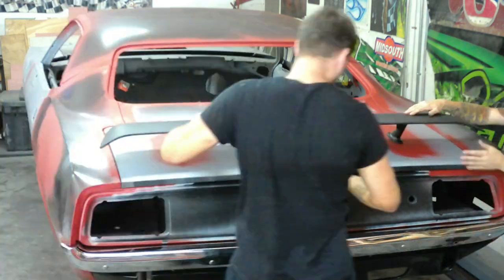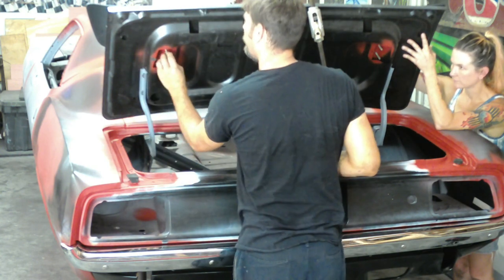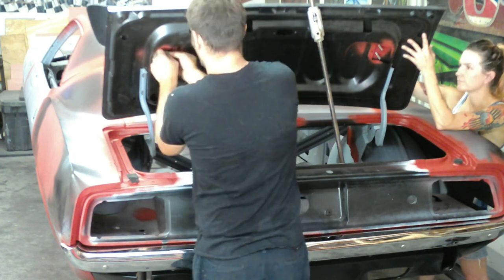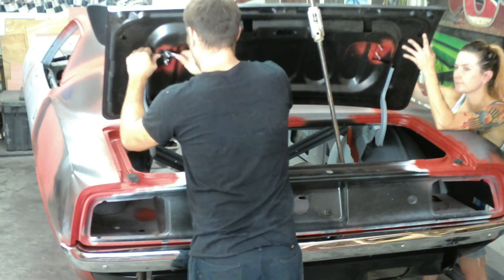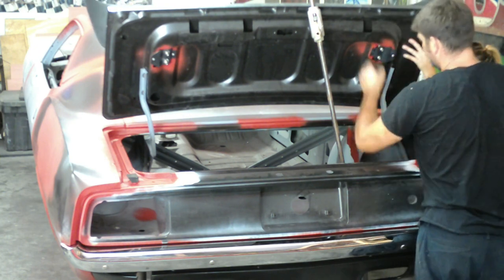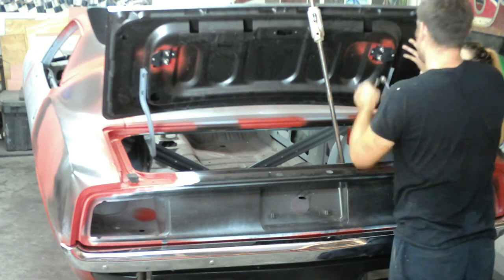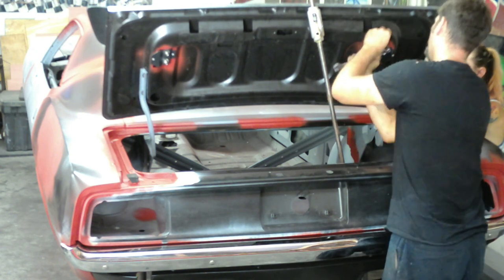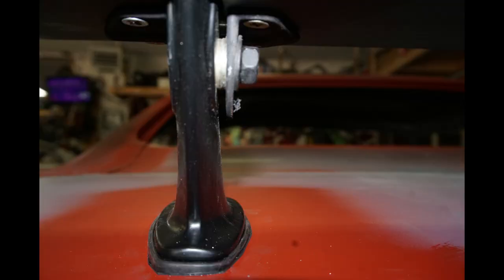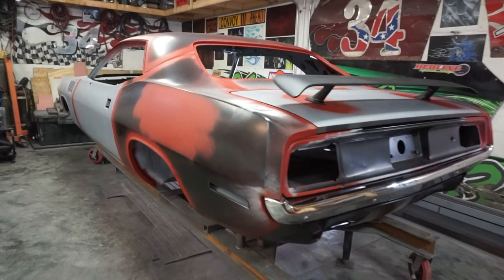Now we're installing the spoiler — it's been test fit on the car and I did have to shim it. I put the back spoiler studs in first, then the brackets come through, then I back the studs all the way down and put the lock nuts on the outside after the brackets are screwed in place. It's a really complicated spoiler — if you've never done this before it can be very overwhelming just to bolt on a spoiler; you kind of have to reverse engineer it. We had to shim it — just one washer on one side and two on the other to get the holes lined up. The brackets are only located in one spot so you can't move it past those brackets. The spacers used as shims ever so slightly center the support beams a little bit more.